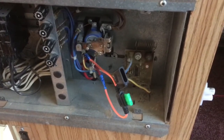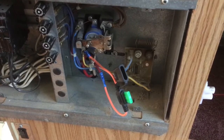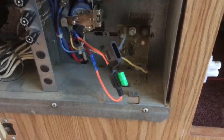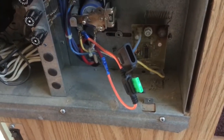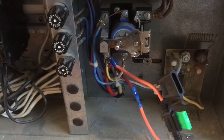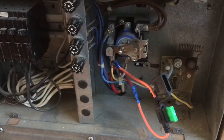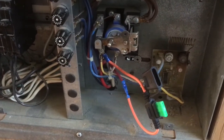I'm back — sorry I haven't been filming much, I need to get a good holder for the camera. So I went out and got a heavy-duty fuse holder and got a 30-amp fuse — the green one there, you can see it. I ran it with solderless connectors, not the best but it'll work. I connected it to the main red wire there and ran it out through the back grommet. Right now the wire is just free — you can see that red wire coming up.